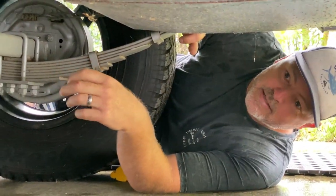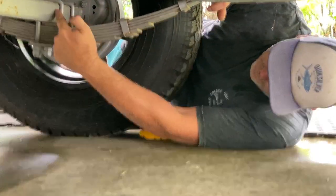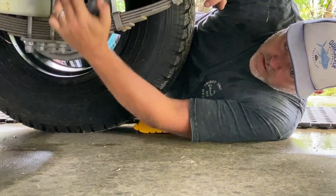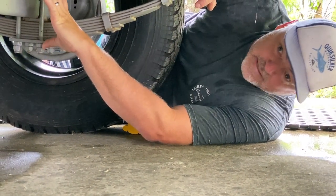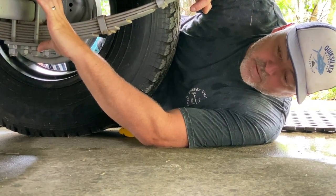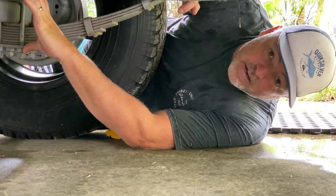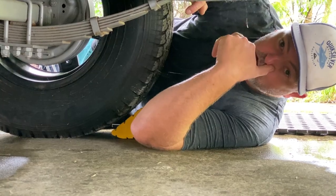So the aim is to actually flip this axle here. We're going to flip it under this spring and we want to mount the axle under the spring instead of on top. So it's actually going to pick us up — probably a hundred mil of clearance. It's going to be lifted pretty high, but that's just an easy way for us to get more clearance. It doesn't change the suspension or anything, it's just going to give us a bit more clearance, basically backing into places and things like that.